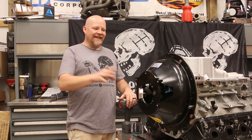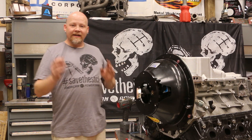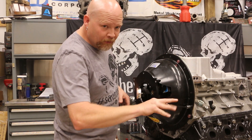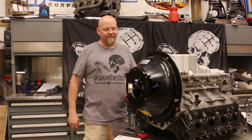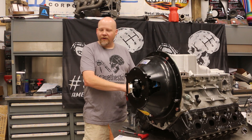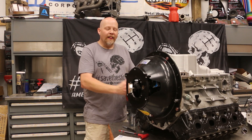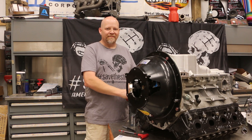Our engine is now safely set up with the bell housing to install the transmission. Now that we've got everything dialed in, we can tighten down the bolts. That's all there is to dialing in your bell housing — we're within spec at 5 thousandths, we've tightened down our dowel pins, and we're ready to install our transmission. Of course, we still have to pull this off, put the clutch on, and do all that — but that's for another time. Thanks for watching. Let's make magic.